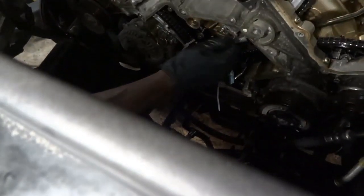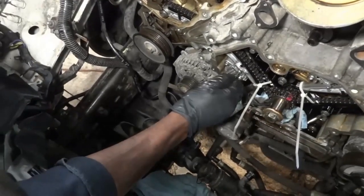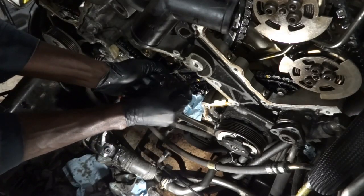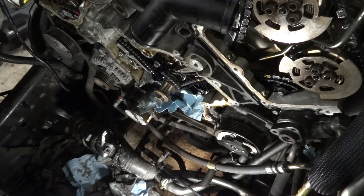I'm going to snug these bolts over here. Now I'm going to release this tensioner first — that's released. Now we're going to release this one — it's good. Now I'm going to remove these zip ties and also this one. I removed the tool on the crankshaft and also the tools on the back of the camshafts. Now I'm going to spin the engine so we can double-check our timing.